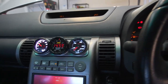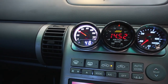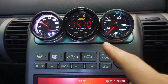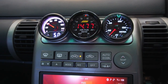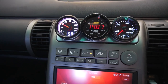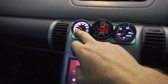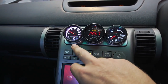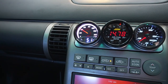Just for reference, this is with the car running. The gauges are on — when I first started, oil pressure was around 90 PSI, which is pretty good. Now it's starting to warm up: we're at 50 degrees on the oil and about 50 degrees on the water as well, which makes sense because of that oil-to-water cooler. The idle is pretty much spot on at 14.7 AFR, which is stoichiometric for just sitting here. One thing I had to change was this gauge's illumination function — it only dims, so I ended up connecting the orange illumination wire to the orange one on the radio so it dims when I turn on the headlights.